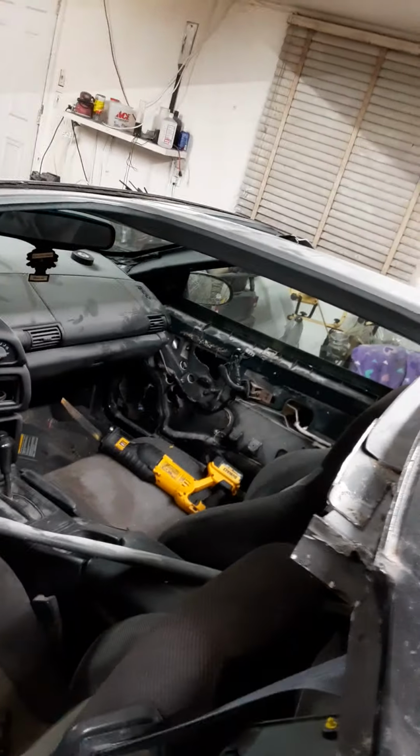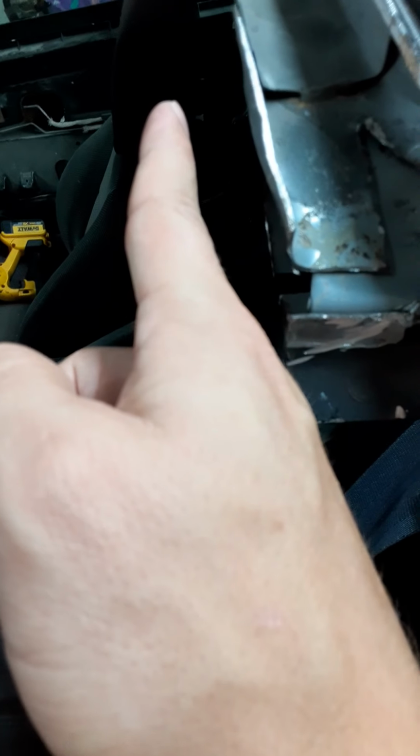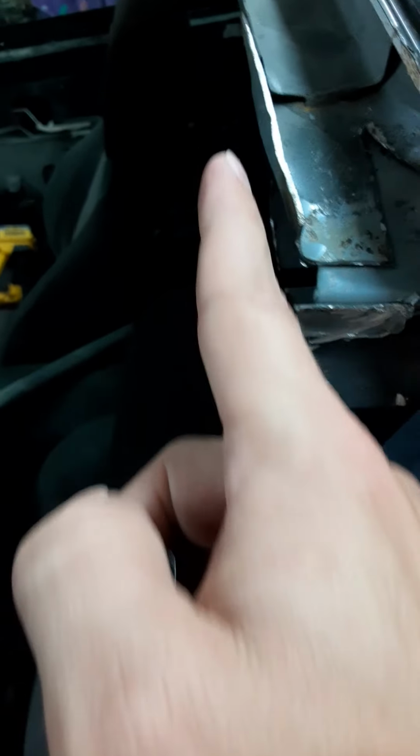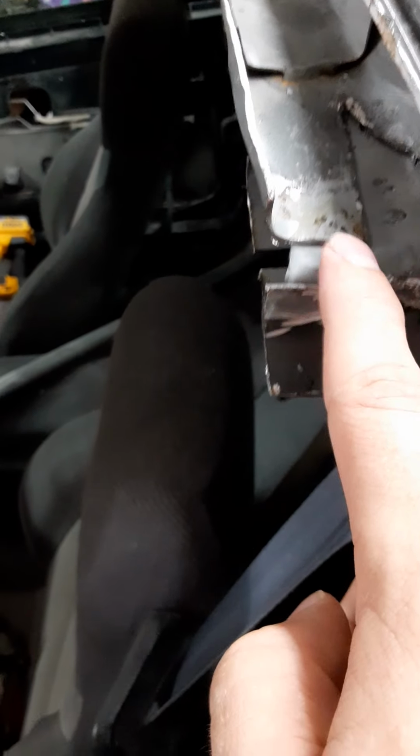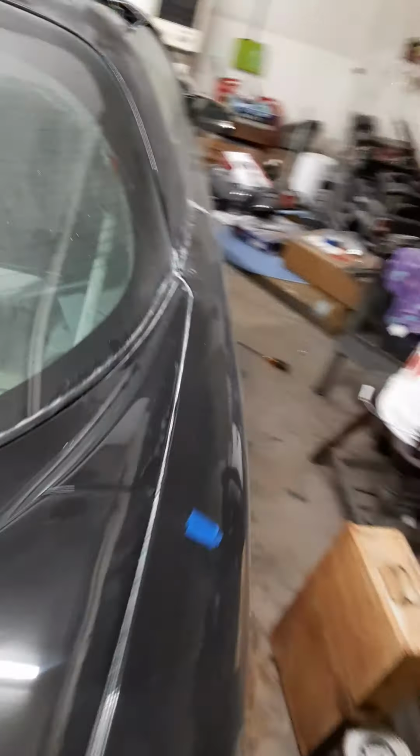I'll show you the cut marks I do on the other side in the other video, but really, I cut this along to here. This was out to right there, pretty much. I still shaved some off, but I folded it up. So you just cut along there. Trim this down, because I think it was one piece that folded over, if I remember right. Let me go look at that other side real quick. I think it was one piece and I cut it out, and I beat it over. Yeah, it's got that arc on it, like the little bend. You'll have to cut it down, and you cut a little chunk out so it gives it a breakaway there, so you can actually bend the metal.